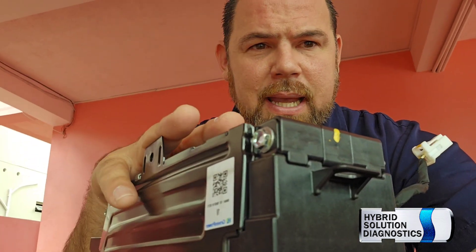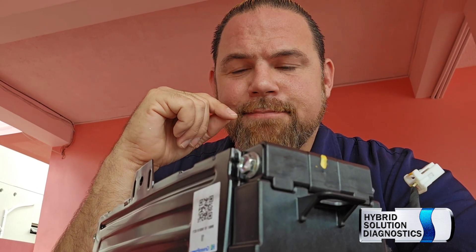For some reason, over time, the charging system begins to lose its calibration because the 12-volt battery begins to have some cells that lose capacity. Something I want to share with you as well is that the very same principles with electric vehicles apply here — you might need to recalibrate the state of charge of this battery with your scan tools every so often, to let the computer know that the battery probably might be losing a little capacity. This is definitely one of the greatest things to do if you want to keep this battery over time, because the level of cycling of this battery shouldn't cause it to begin to swell four or five years after being used — they're supposed to last way much more.